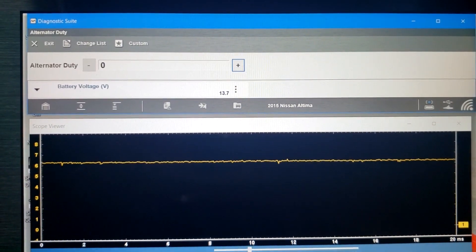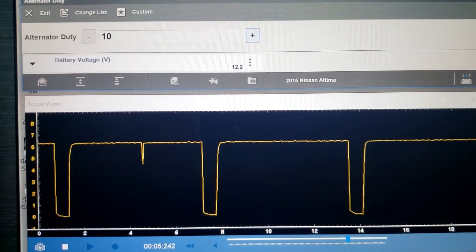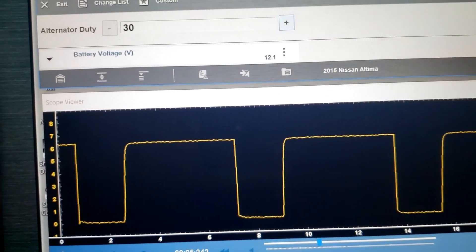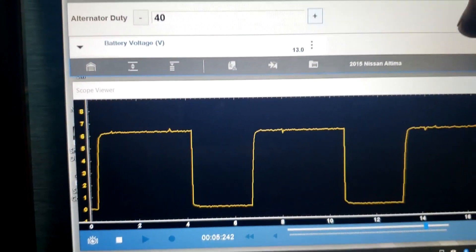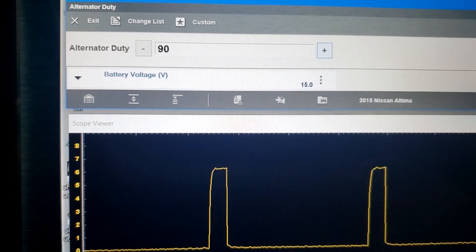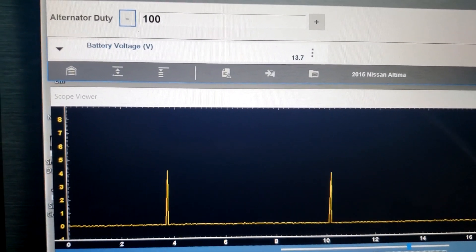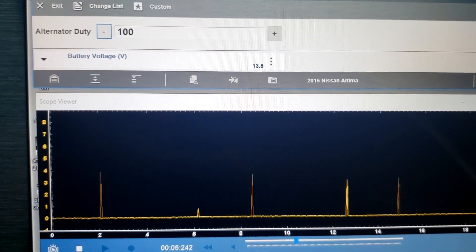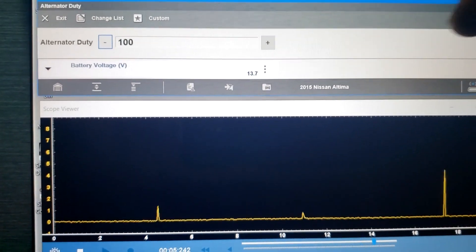All I'm going to do here is watch battery voltage while I command the duty up with the scan tool. There's 10% — notice the voltage dropped. You can see the square wave on the scope. I'm back-probed at the IPDM. The more I command the duty, the more voltage I get, but remember a low duty means it commands low. So I'm up to 40% — 13 volts. I go up to 80 and 90 — it jumps up to 15 volts — and then at 100% it acts like the wire is shorted to ground, so it reverts back to a normal alternator. It's not 100% computer controlled. There's only one wire that does this. The ECM makes a decision, sends signals to the IPDM over CAN, and this signal comes out of the IPDM.